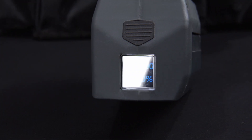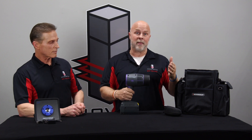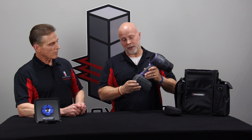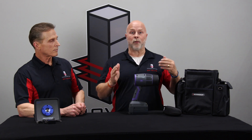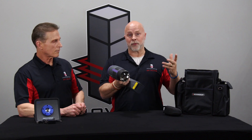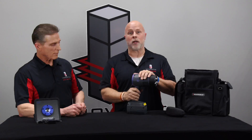What's really nice about this unit is it has a count-up timer in the back, so it tells you exactly how long you've been curing. Most large repairs the size of a basketball can be cured within a minute with pretty much any manufacturer's UV primer. The lights are designed to work between 365 and 400 nanometers — that's the wavelength range to activate the photo initiators. This unit is at 385 nanometers, right in the sweet spot, which covers all major manufacturers.